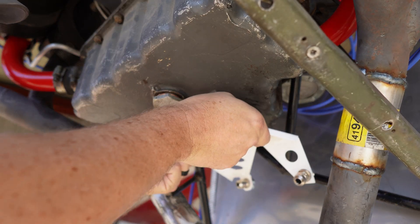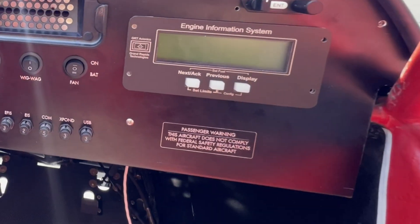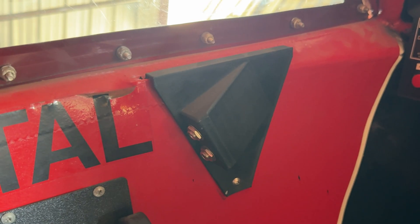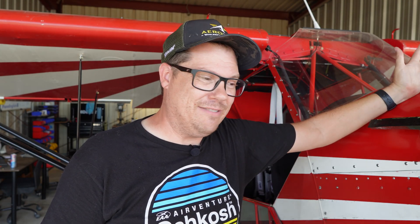I needed a custom cable for what I have set up on the engine, and that cable was going to cost a lot of money I didn't have at the time. So I ordered cables from Van's because I'm using a Van's throttle cable mount on the engine, but I couldn't get those to go on the left side where the traditional throttle is for a Cub. Since I'd already committed to using everything with my right hand, it made sense to make a cover panel to go over my passenger warning placard — which really hurt my heart because it was so beautifully etched — but I put that cover over it and installed the control cables there. On the other side where the throttle used to be, I made a 3D-printed cover for my headphone jacks, and that's worked really well.